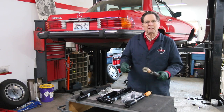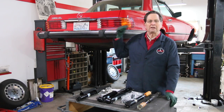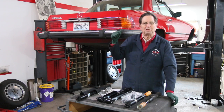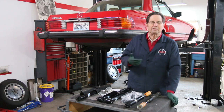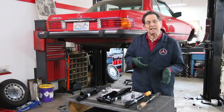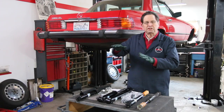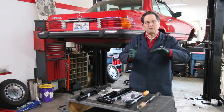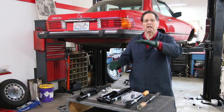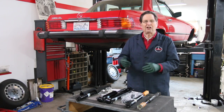When you're pushing up and down, you're only pushing with maybe 100 or 150 pounds, and you might have a thousand pounds on one shock absorber. That's why you really can't test the shock by just pushing on it — you can get some kind of idea, but the better way is to push up and down on the car, or take it out and drive it. On an open road, just swerve back and forth and see how much the body rolls. If you get a lot of body roll, you know the shocks are gone.